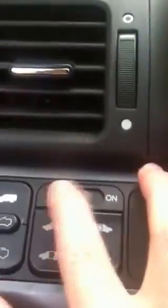Turn the key two clicks — starts at zero, then one, then two. I didn't turn the vehicle on; it's just been turned over two clicks. Normally what I would see on my dashboard is the door light on, but it's not on because I've already reset it. Then I actually test my doors — they don't work with the remote, and obviously they're not going to work here because the switch is turned off. I turn it on, and same thing — it doesn't work, because that fuse has been pulled.